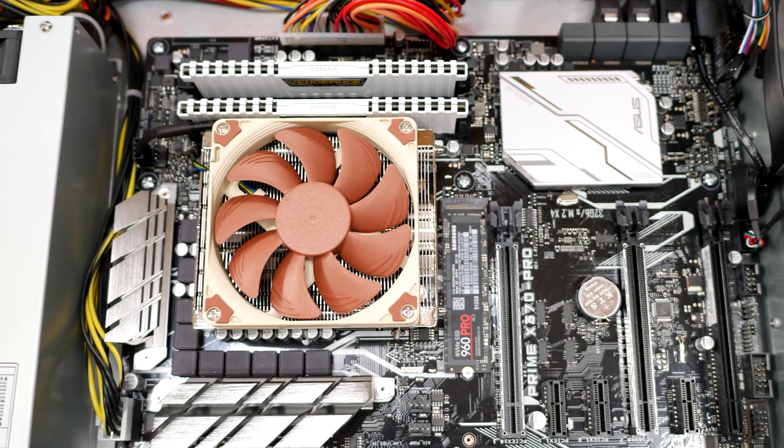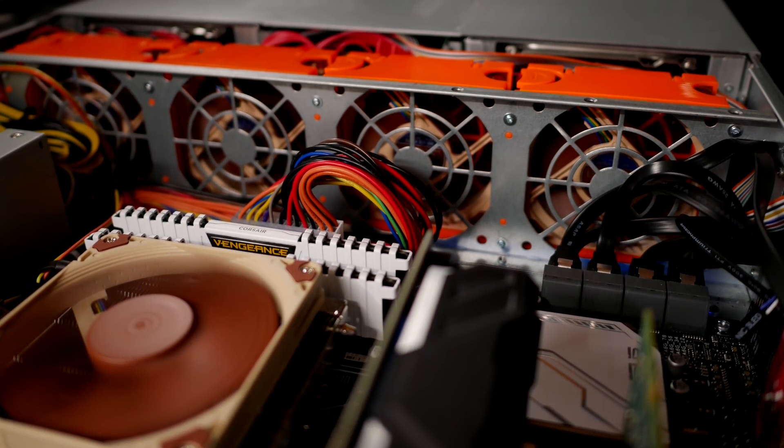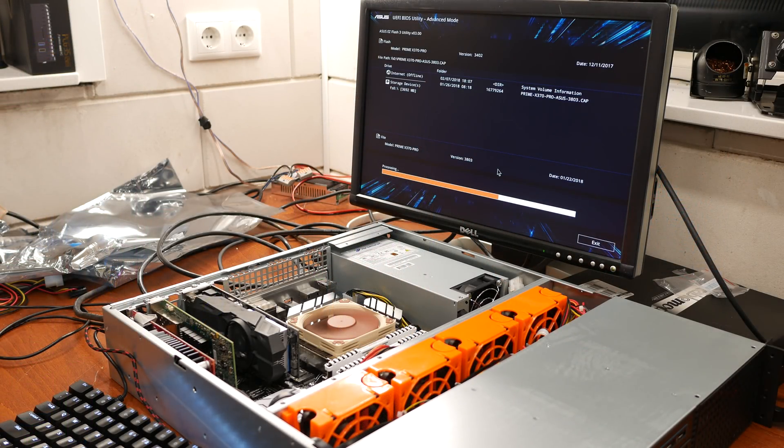So now you have one header on your motherboard which can control 4 fans. I've set my BIOS to turbo mode for the CPU fan and to silent mode for the chassis fan. I've measured the temperatures in Linux for the video card, network cards, and other components, and that still seems to provide enough airflow so that nothing overheats. Let's listen to some samples of the chassis running with the stock fans, and of the Noctua fans quieted down using PWM from the motherboard.